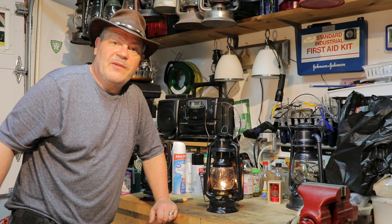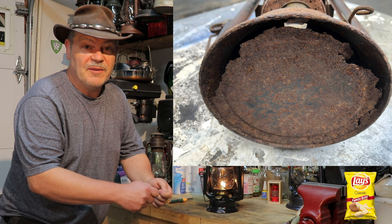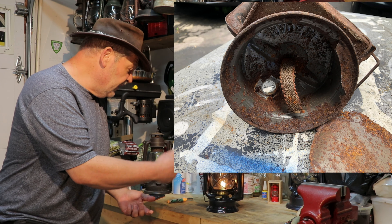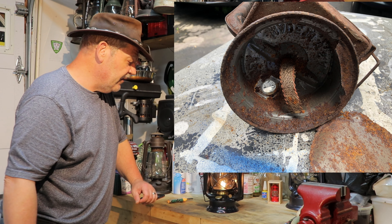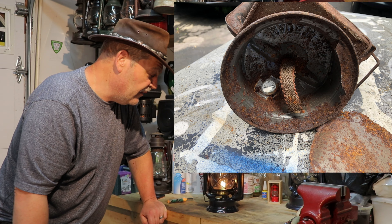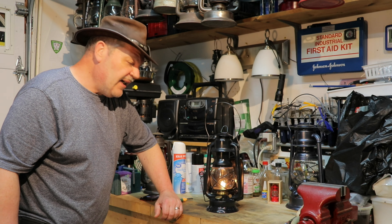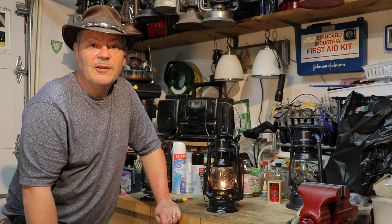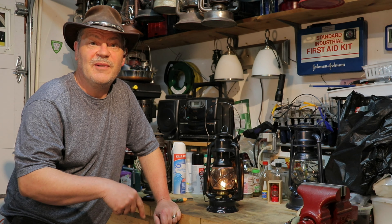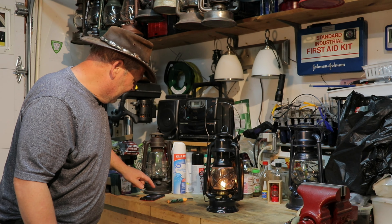I'll post the pictures as I'm talking. The whole bottom was roached out — it was like potato chips. I basically had to go in there, remove the whole bottom, clean it up; it was all jagged around the bottom. Shortly after I removed the bottom, the burner was seized in there too. I went to pop the burner out and the whole burner housing, the whole burner ring, popped out too.